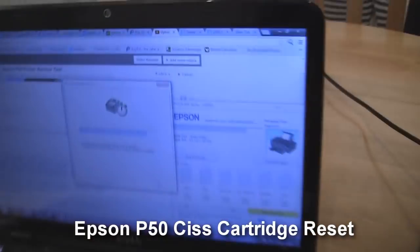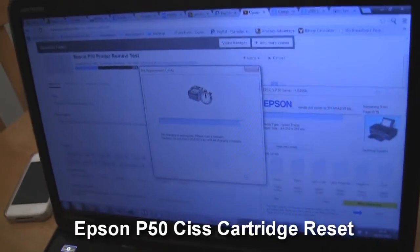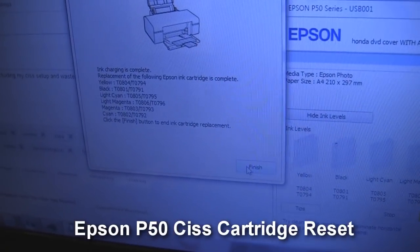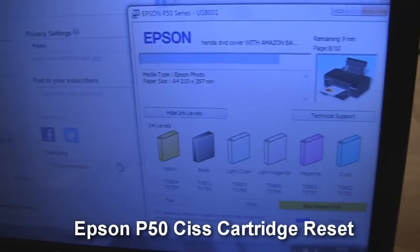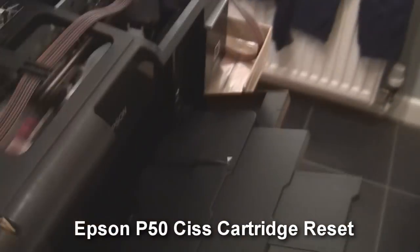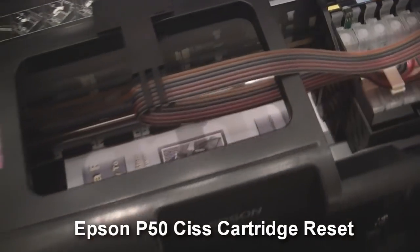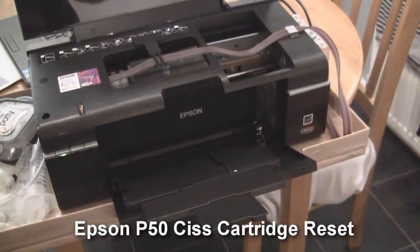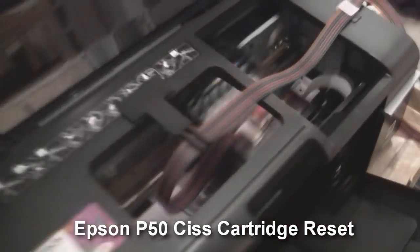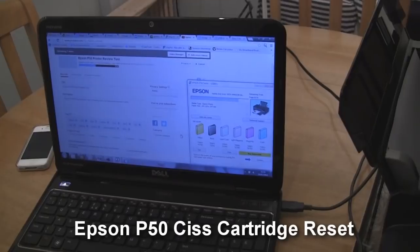So it's gone through the procedure, it's right near the end. Hopefully I'll be able to resume my printing. Notice here as well, of course, the ink levels are showing at zero. Ink charging is complete — we'll click finish. There we go, we have a full set of cartridges. We're back up and running, and once again printing some DVD covers — I'm a happy man. Epson P50: how to reset the CIS if you're having difficulty and the button doesn't work. Pull them right out, push them right back in — no turning on or off, no reset buttons or anything. Thanks very much for watching. I'll post more videos on this Epson P50. Thank you.